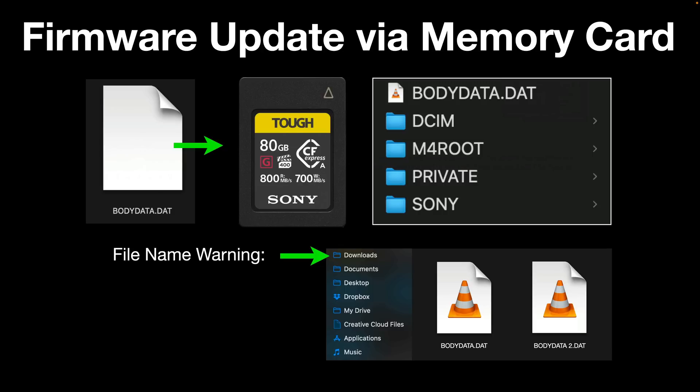I will warn you: if you download both the 1.05 and the 1.1 versions, you will encounter a problem because both firmware upgrades have the same file name, which will force your computer to rename the second download. So we need to avoid this. If you are going to download both versions now, drag the first version out of your downloads folder before you proceed to download the 1.1 version. That is perhaps the most problematic area of this re-release of the 1.1 upgrade.